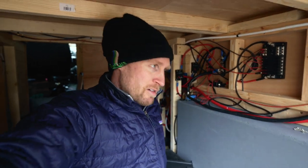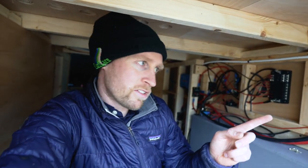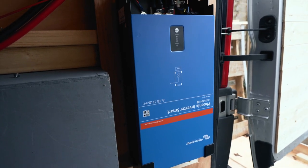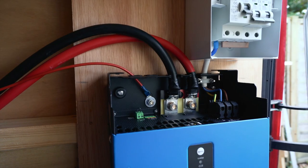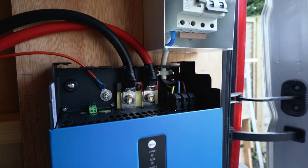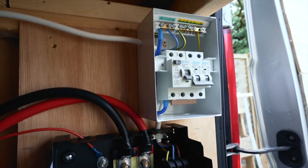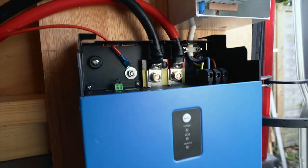So annoying keep banging my head on the roof, but I think we're there. Don't judge my electrical tidiness because I know exactly where everything goes. I say this quite often but restriction breeds creativity — if you haven't got much space to work with then you've got to get a bit creative. I think we're ready to fire up the inverter, but I'm just going to run through the whole system to make sure it's all done properly before we fire it up. So this is our lovely inverter — I mounted it upside down because I needed all the connections at the top rather than at the bottom. In the top we've got the two big power cables coming from the battery, the red and the black, and then on the right we've got the AC out which goes into the consumer unit, and that white cable connects up to all the other sockets in the van.